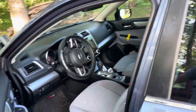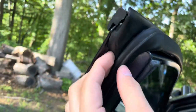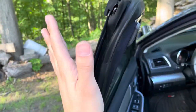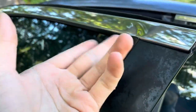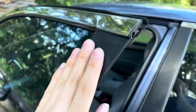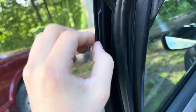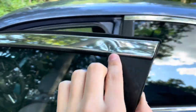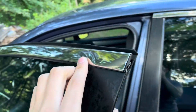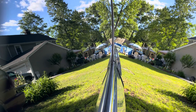This next step is crucial — don't skip it. Depending on how your door pillar is set up, some have pop-off clips or screws. I'm going to take the easy route and just move the weather strips out of the way. Roll your window down, peel the weather strip back, cut the wrap right here, and tuck it behind. If you want to go through the work of taking the whole piece off, you can — I got a little dent trying to mess with it. My chrome piece is bent a little but I'll replace it later. Sorry guys, I don't have a great angle to show you applying it.